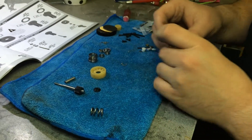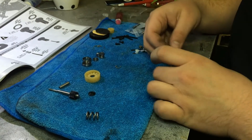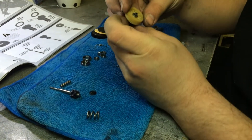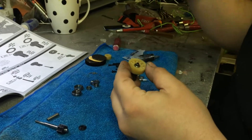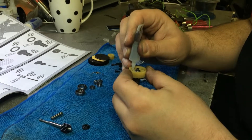We've already got our other one done. What I like to do is take our bearings we're going to use with our ball diff and put it on. I go ahead and set the gear on right away, giving me a closed back so I don't drop any balls. What I do then is fill up every hole with a clear stealth diff grease.